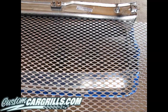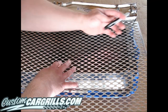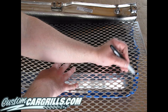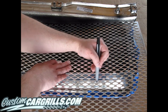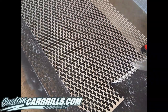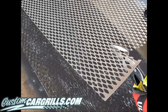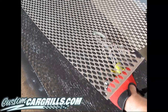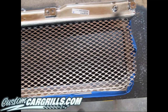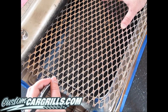I just laid it over the back of the grill and I'm going to get this slid over so we have a minimal amount of waste. I usually like to just take a Sharpie and mark off a rough outline, maybe an inch to an inch and a half past where the mesh is going to fold over. This will give you enough excess to work with if there's an issue. You'll also need to cut out the excess in a couple of sections. When dealing with this material in a large size, sometimes it's a little bulky and it helps to do it in chunks. After I'm done cutting, I'm going to take the Sharpie with the material laid right over the back of the grill and outline in very fine detail where the mesh and the grill meet. This is going to be our guideline of where to bend the mesh so that it folds over the back of that grill.